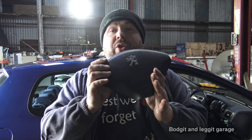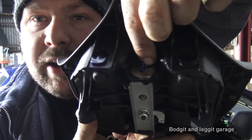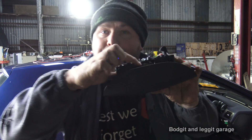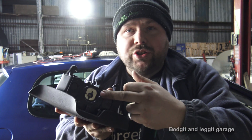Getting now to the actual testing — very simple, you just need a multimeter with a resistance test on it. Really is as simple as that. The hardest thing is we need to get the ground pins and push them back, and we need to do it with both. You can't see the other one in there but if you've got a two trigger airbag you just do it on both sides. Let's get this on the bench and get you a bit closer.